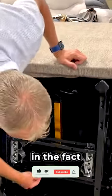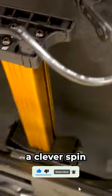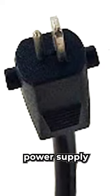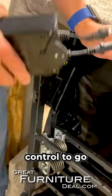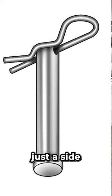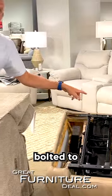A chair motor is different in that it has a clevis pin. So a chair motor has two bolts on this side, a clevis pin in the bottom, a five-pin connection for the control, and a two-pin connection for the power supply. This one has a battery — that's how it's controlled. So if you have a wired control it goes here, or the battery goes there. The chair motor has no connection up top, just a clevis pin, which is a side pin that clips in. A chair motor is actually bolted to the frame.